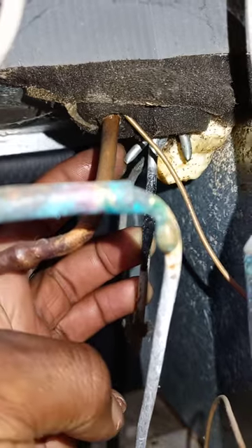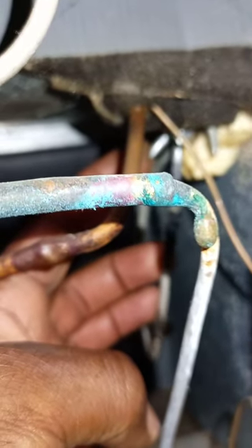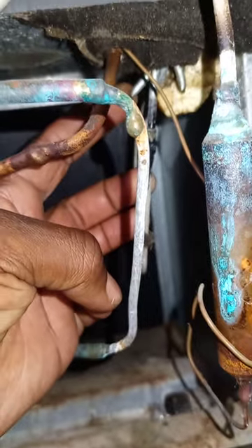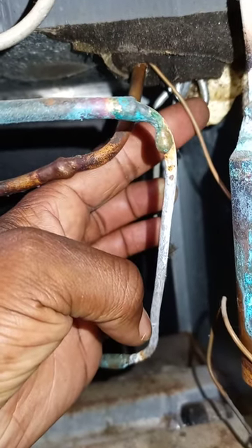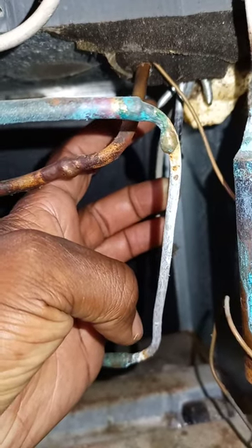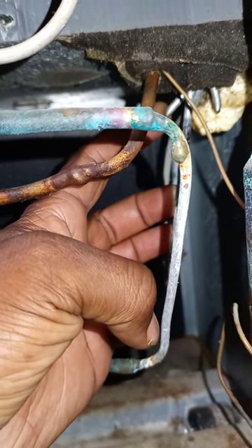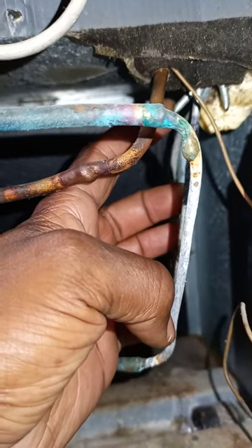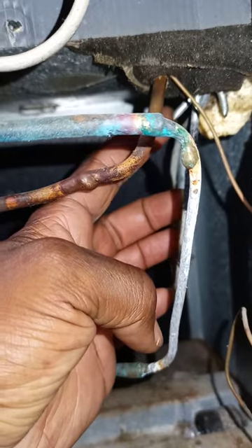I checked it and saw that it was leaking. This pipe was not short like that when I was testing it. I fitted my service valve here. When I saw that it was leaking, I just decided to use another condenser. So with a service valve here, we close on this side — if we vacuum for 15 minutes and go back to zero, we know the condenser is leaking. If we put gas and after 15 minutes the gas is dropping, we know it's leaking and we won't use it. That's how I tested the condenser. I didn't buy a new condenser — I just took a condenser from a fridge that I was scrapping.